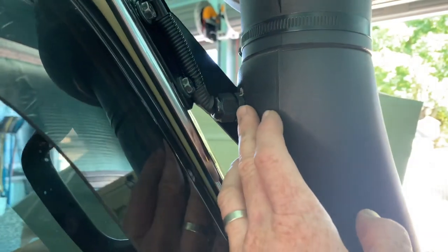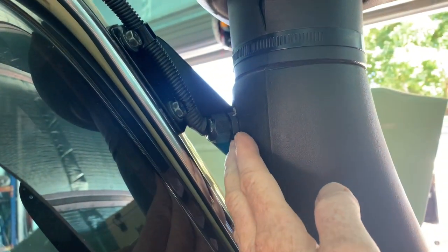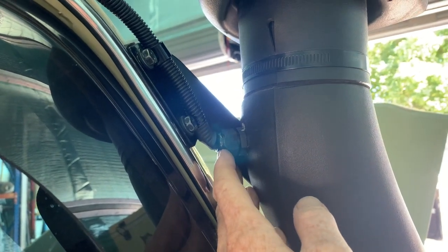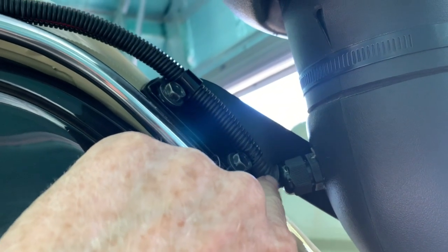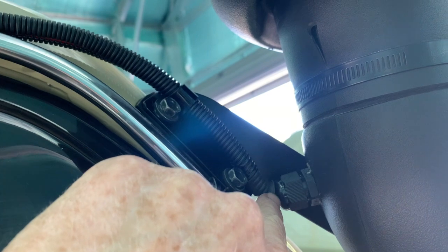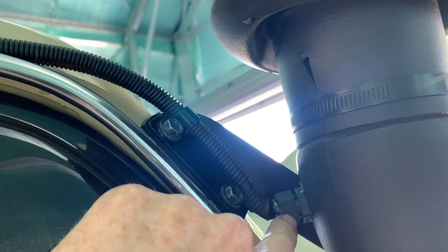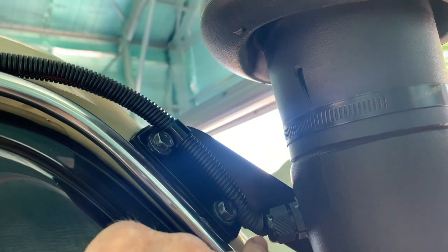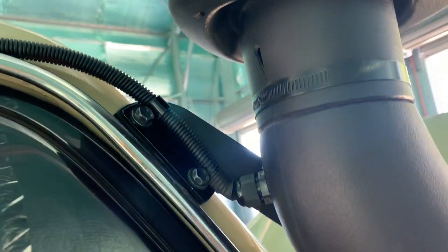So we've got a cable gland nut there. There's a rubber seal behind it, clamping down hard on the plastic, creating a water seal. There's also a rubber grommet inside that, as you do it up, clamps down on the cable and really creates a watertight seal. One little trick we've done here is some heat shrink over the end of the sleeving. It shrinks down on the sleeving and also on the cable, allowing a small round amount of cable to go through when we've got an uneven number of strands in here. That allows a round surface for that grommet to really bite down and create a watertight seal.